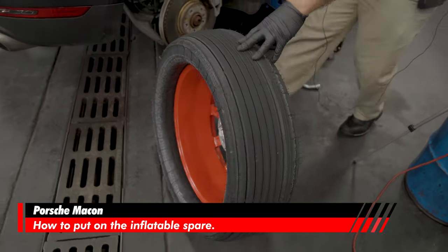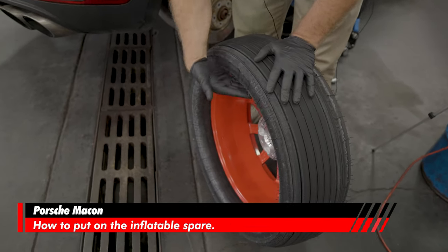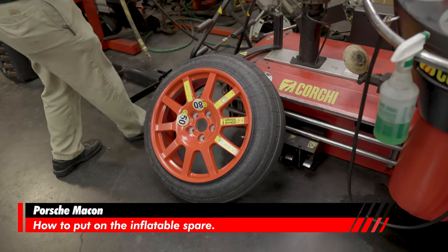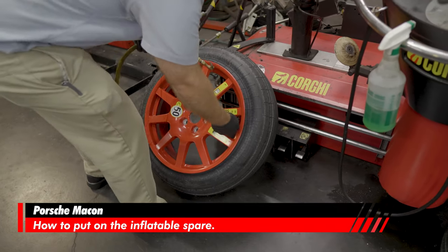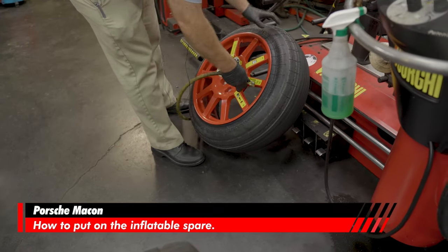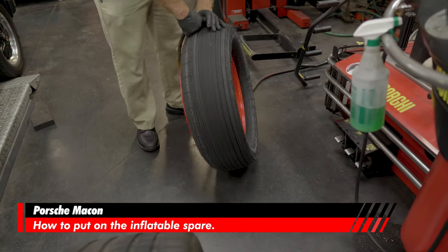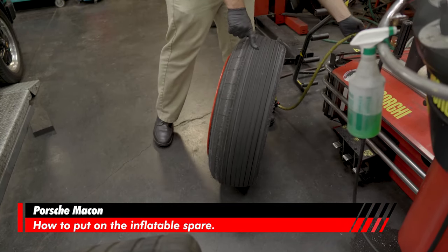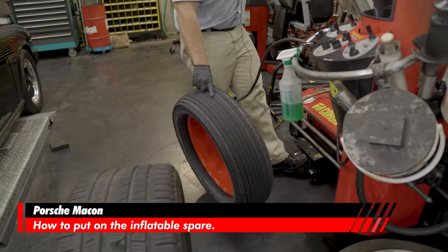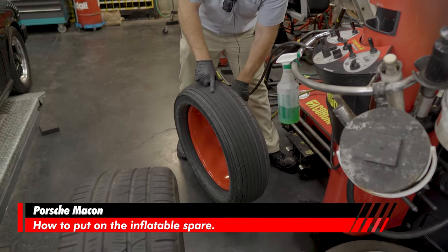The spare tire on this one did not get pumped up far enough, which is a little bit dangerous to drive on. See how this side is curled over and this side is super pulled out. Let's fully inflate it and show you what it should look like on the car. Right now it doesn't have enough air — the PSI it wants is 51. Right now we're at 20; the tire probably came in with about 10 or 15 in it.